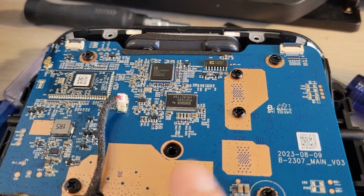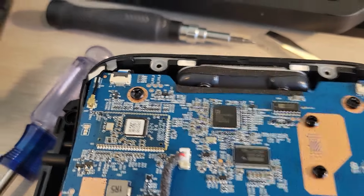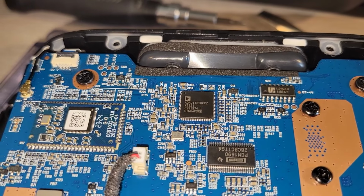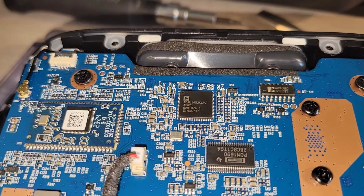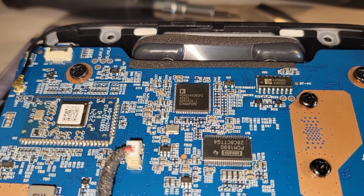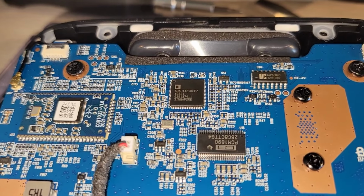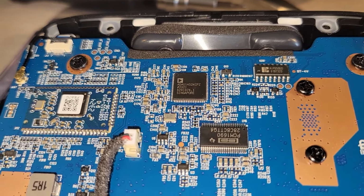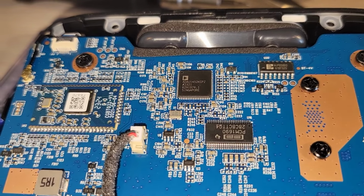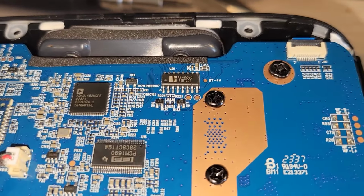So, this chip, I don't know, we'll look that up, but as you can see, our main audio processor is this one, ADAU1452. It's an Analog Devices chip, and I'll include the wiki for SigmaStudio that's used to program this chip down there in the description, and you'll see just exactly what the spatial audio is all about. It's pretty much just stereo mixed into a kind of special mix where it makes you feel like you're listening to a big speaker. But no, it's still stereo. Keep that in mind.